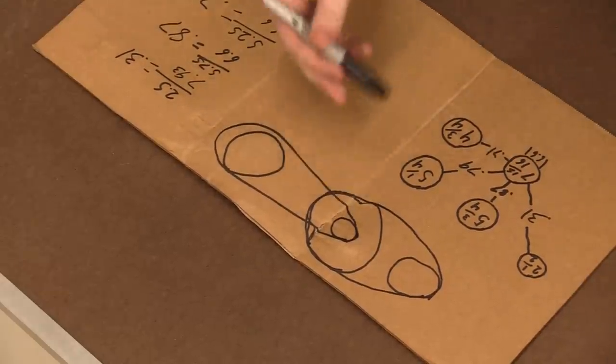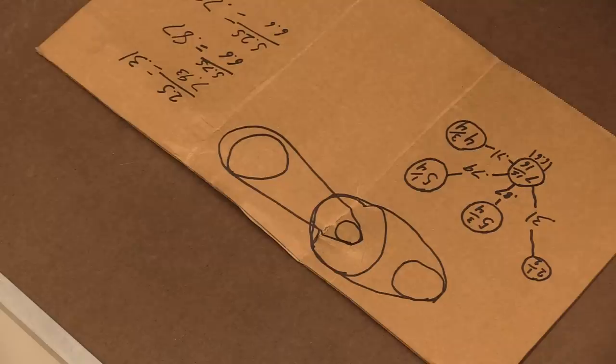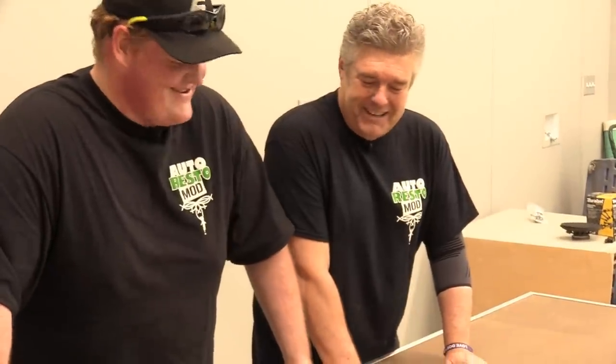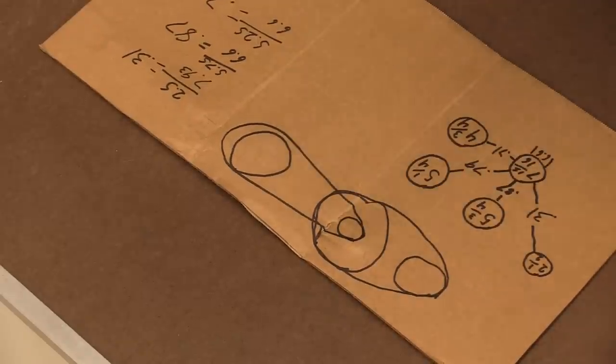This gives you gear reduction basically in the system. One of the things you can run into with these cars is that a '67 could have originally come out with a 289 and nothing on the car — it would be a one-sheave crank pulley. And that's what happens a lot of times: guys want to start adding accessories. You have to remember — 50-plus year old car — and I mean anything could happen. Guys will go in and put the serpentine systems off Fox Body Mustangs, but those are horrifyingly hard to find.